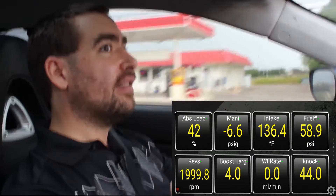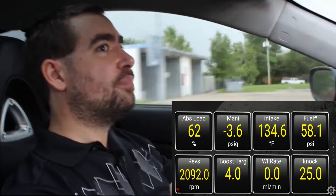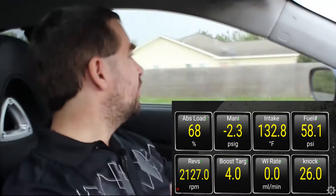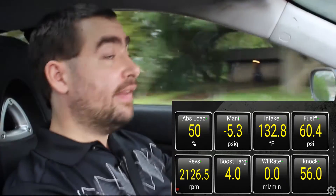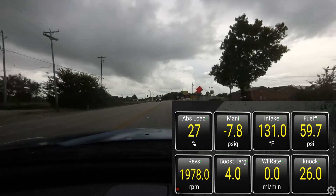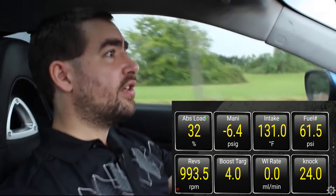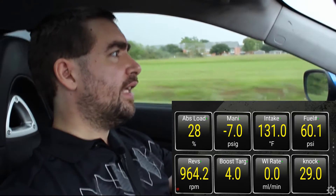I am getting a little bit of spark blowout — I need to figure that out, it's going to bug the crap out of me. I do have to rewire the coil, so that's going to be on another episode here shortly. Changing out the spark plugs really did make an absolute huge difference. The old dirty spark plugs were causing some of the misfire. I'm thinking I might have a little bit too much water injection on the top end, and that could be causing the misfires now too. We'll have to see.